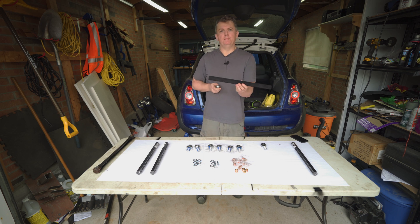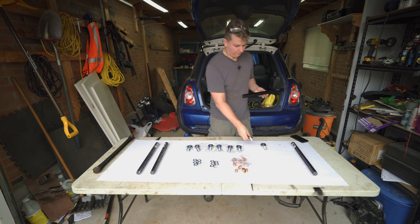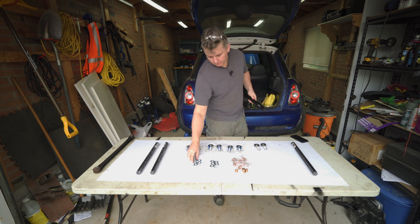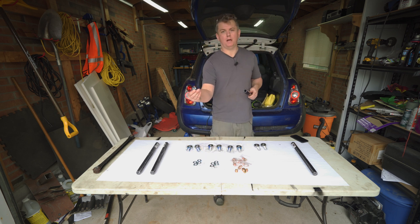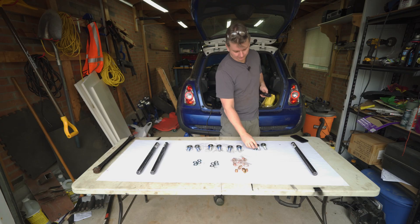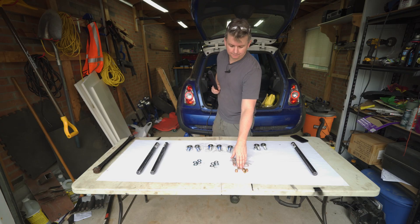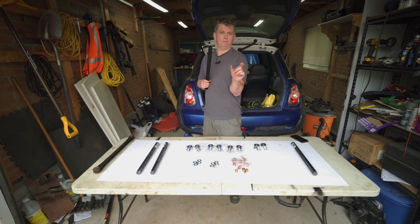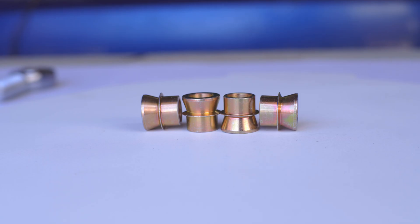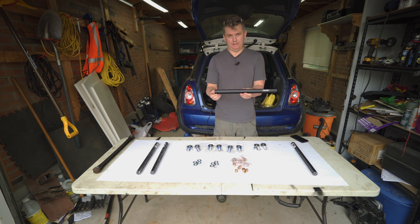The actual process of building the control arms is: you need two rod ends, one bar, and two stop nuts — again, those are left and right-handed. The left-handed one has a little set of arrows on it. Once you're going to install them, you have these offset spacers that will fill in the gap where the bushing used to be and give you full mobility inside, but they're solid metal so it's quite stiff. The process is actually quite easy.